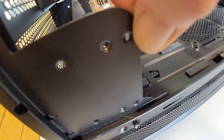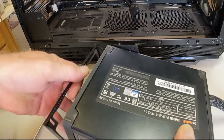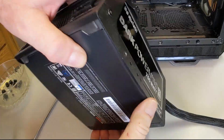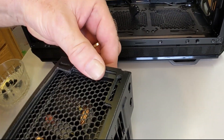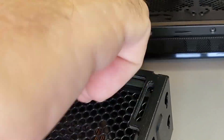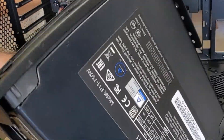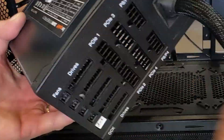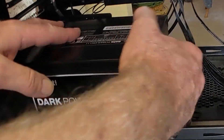You have several settings to choose from — I found the middle one works easiest for me. The PSU gets attached into a sled using the standard back screw holes with thumbscrews that Be Quiet includes. Note that whether you stow the unit right side up or upside down, it will show the text right side up through the side window. You will have to set the power switch on now, as you will hook a small extension cable to it and a new switch will be on the outside of the case because this one will be inaccessible inside.